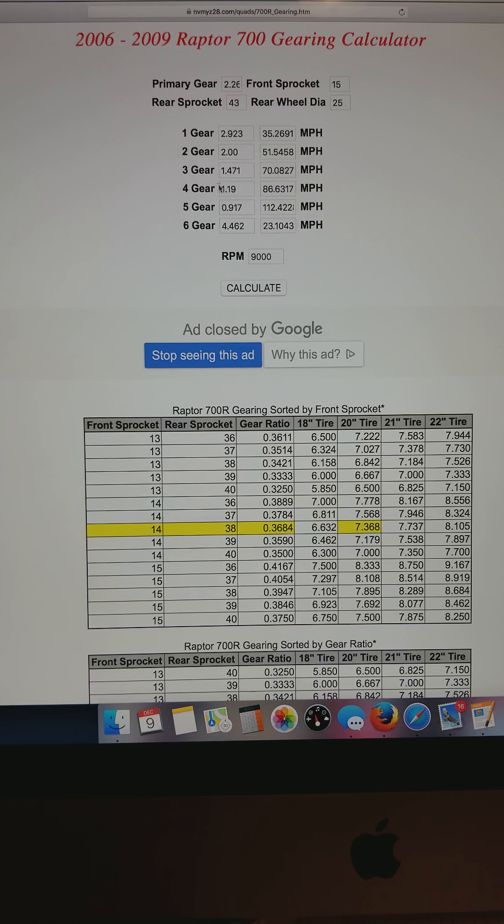Where this bike is going to rev much higher at the same mile an hour — so to change that, if I bump this to 10,000 and try to get this number up to 91, let's try 9,600... so it'd be about 9,500. Basically a 500 RPM change in where that engine's revving, making that fourth gear ratio closer — call it a close ratio fourth gear, or the 1.19 fourth gear ratio.